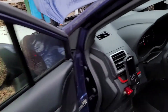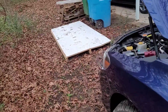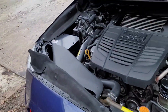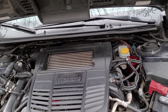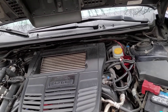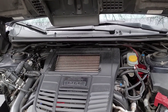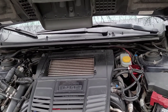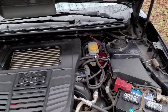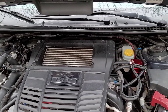It does the job. You can monitor temperature drops on the manifold temperature sensor through the Accessport. In really hot temperatures, if your manifold intake temperature is around 130–140 degrees or higher, and you let it spray before you take off, you'll definitely see at least a 15-degree drop, which I think is pretty good. I'm currently Stage 2 and didn't want to change the intercooler, so this gives me more cooling in those hot summer months. I'll link all the parts below, and if you need help getting it set up, just hit me up with a question and I'll answer as best I can.